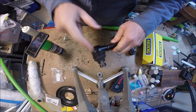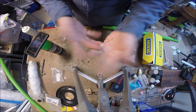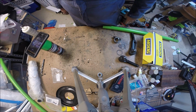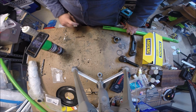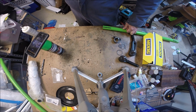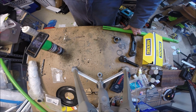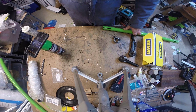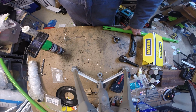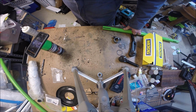This right here, the dimensions of this stud are too wide. Oh, sorry, that's my Rugged Ridge stud. I already put away the other stud. The dimensions of the 1-ton studs are too wide for the hole in the knuckle, so you have to ream that out. I believe when I priced it out for Stinky Fab, again with no steering damper, it was really close to $500 for everything I would need, including a bracket that would fit on their aluminum system. That's the other thing about Stinky Fab, is theirs is made of aluminum instead of steel.